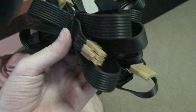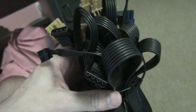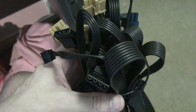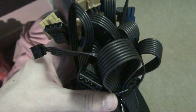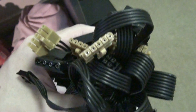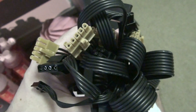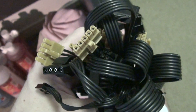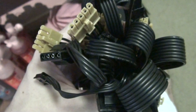There are three SATA cables each with three SATA power plugs on them. There are two Molex cables, each with two Molex plugs, and one also has a floppy connector. There are also two PCIe six-plus-two pin and two PCIe six-pin connectors — all within two cables, so each cable has a six-plus-two pin and a six-pin.